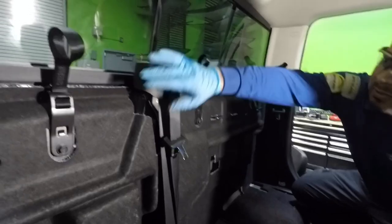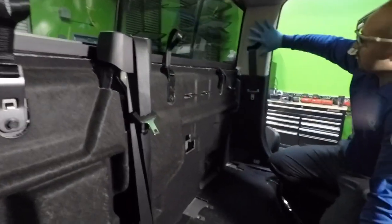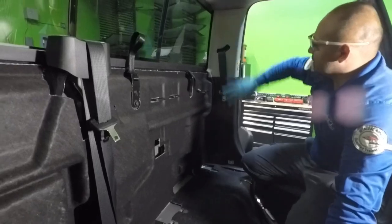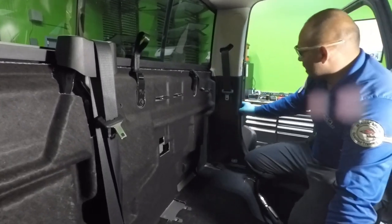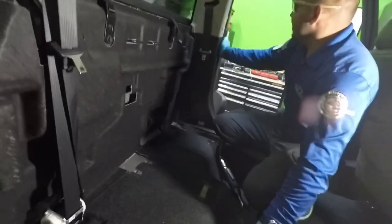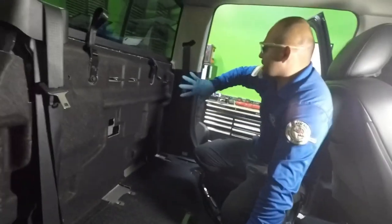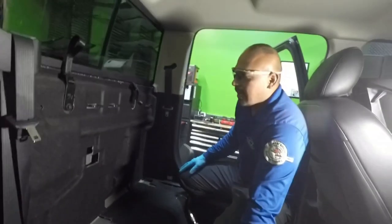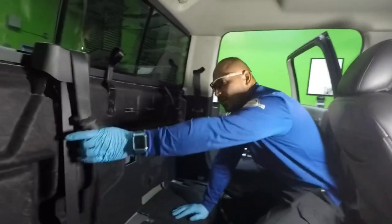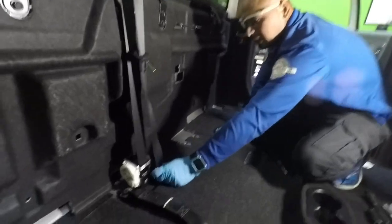This one has two 13 millimeter bolts right here on the side. And then put this one first, put the screw, and then put this one second. Be careful here with the rubber, make sure everything aligns correctly. But yeah, you definitely want to put this on before this one, because this one clips in on top of this one. Now I'm going to get the seat, and this is going to go into the seat, and then it's going to get bolted in here.